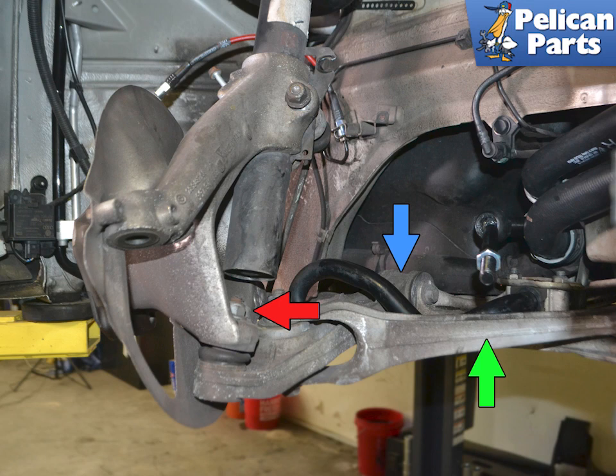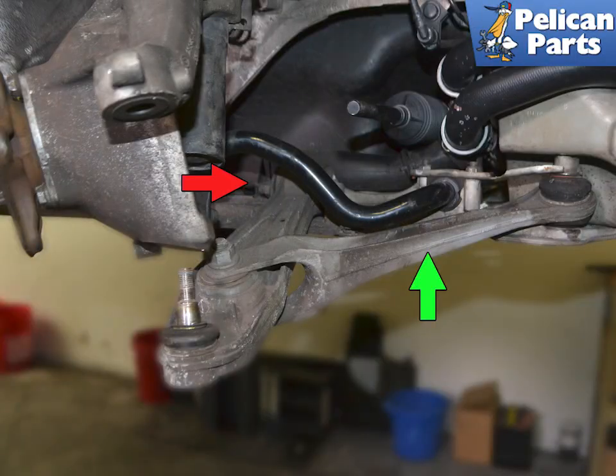The lower control arm, or coffin arm, connects to the subframe and the wheel carrier via a ball joint. The triangulation and strength is assisted by a forward diagonal arm. Unless you have a GT vehicle, the camber is set by the shock at the top where it meets the chassis. With the wheel carrier off, you can see the ball joint as well as where the coffin arm and diagonal arm connect to each other and the subframe.